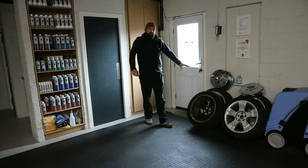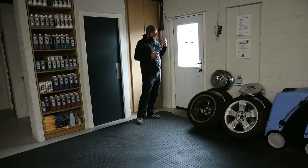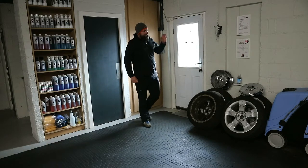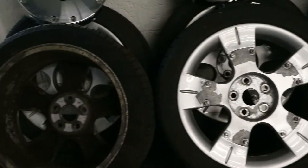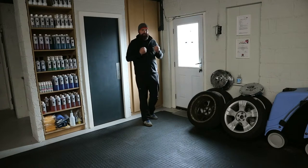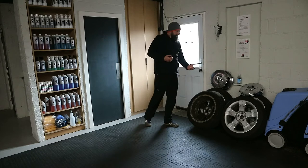So this morning these are going to get dropped off. I'm going to have a word with Mark, who's the manager there, and discuss what I'm looking for these wheels. They are in a very sorry state. Inside is just completely gone — there's no lacquer on there whatsoever and the front face, as you can see, is in very poor condition. The disc sections trap all this dirt and horribleness that just sticks to the alloy wheels. Through numerous heat cycles — heating up, cooling down — not being able to get washed and remove that debris, it just leaves them horrible and they start to peel.